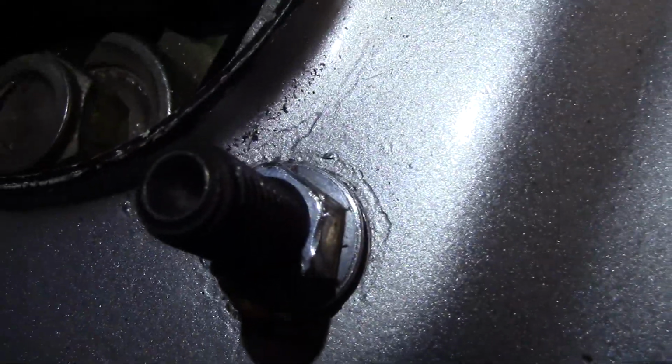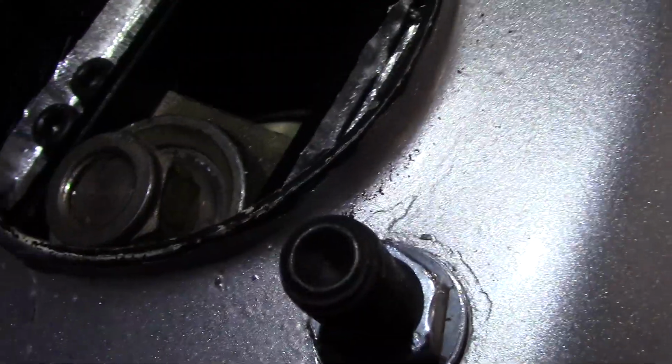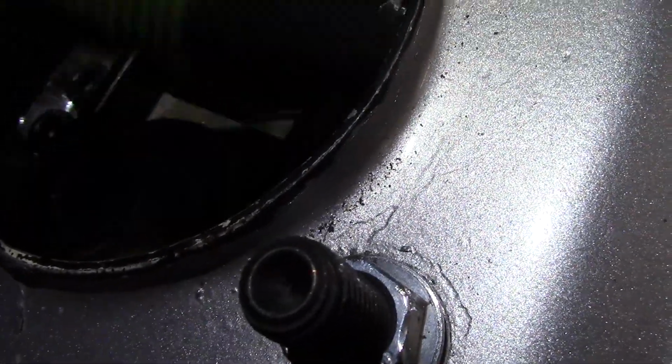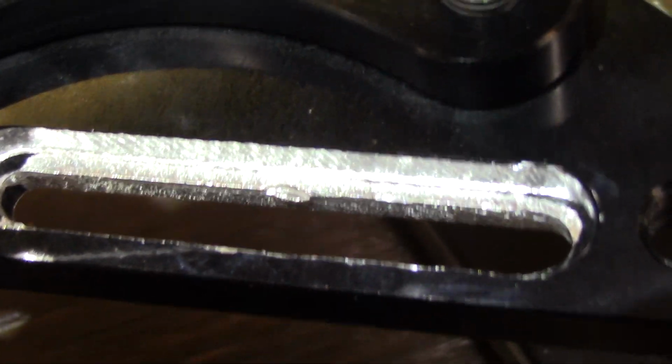So I don't know how much I want to mess around with trimming a washer to fit. It might be nice to save the metal, because if you tighten it down too much, it'll actually wear little chunks. If I can get this on camera, this camera is so old. But yeah, see, it'll take little divots out of the side. So either you just don't crank them down super crazy, but I mean, you want it to hold, right? You want it to lock your camber in place.